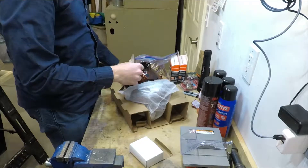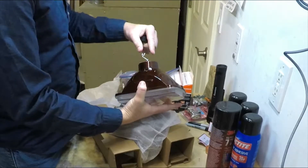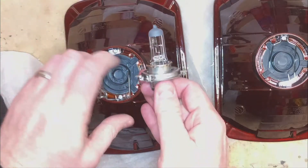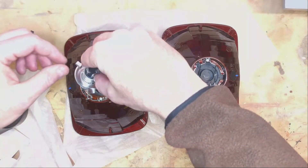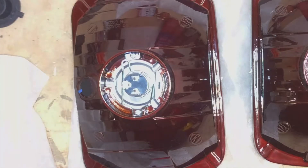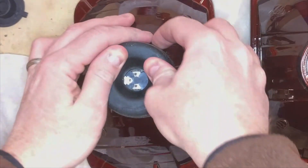There are all-LED kits you can buy and put on there, but we're going to give these a try. Hopefully they're easy to install. This little dust cap is going to be removed permanently and the bulb is going to swap in there instead. As always with a halogen bulb, do not touch the glass — the oils from your fingers, or just the general grease and dirt you might have picked up during the day, can actually create a hot spot on the bulb and cause it to burn through. These do have an orientation marker up here — yep, one way only, so that is correct. The way these work is they seal off facing down, and these little vent tube escapes may be facing down also.